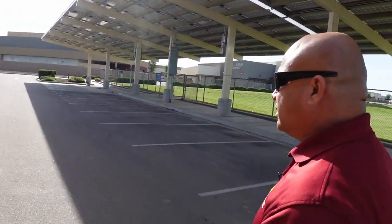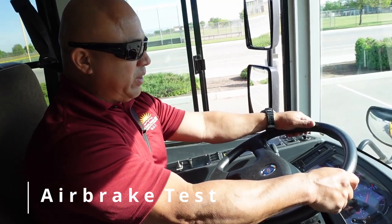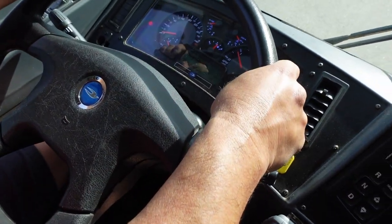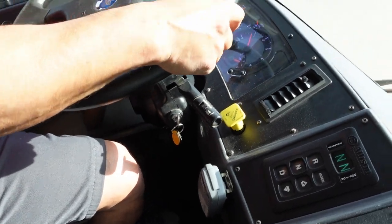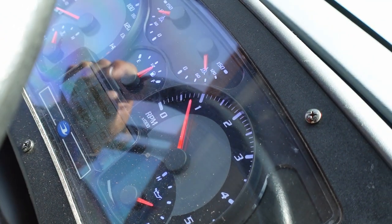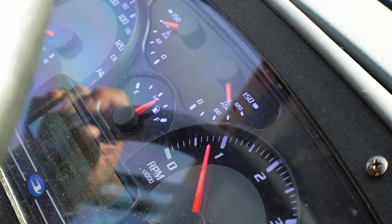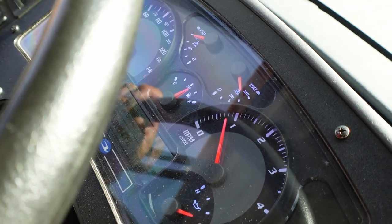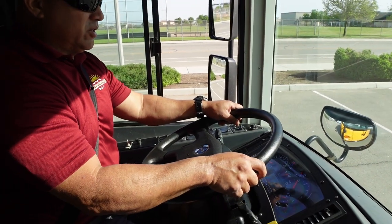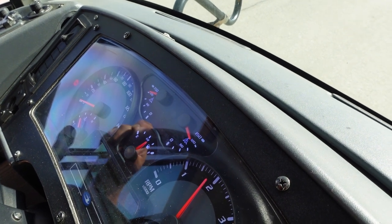Next I'll be doing my air brake test. The first test is my cut-in — cut-in should be no less than 85 PSI. The way I check that, I'll press my service brake and watch for my needles to rise. Pressing my service brake and releasing, counting to myself: one one-thousand, two one-thousand, three one-thousand, four one-thousand, five one-thousand, six one-thousand, seven one-thousand. My needle started rising at about 100 PSI, so my proper cut-in is at 100 PSI. Next I'm going to check my cut-out — cut-out should be no more than 130 PSI. This bus normally cuts out at about 120. That was my cut-in and my quick release valve. My cut-out was at 120 PSI.